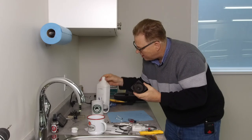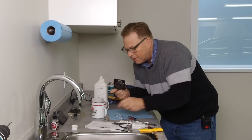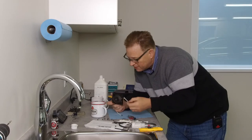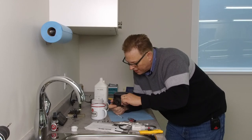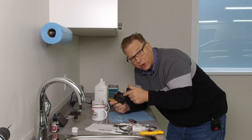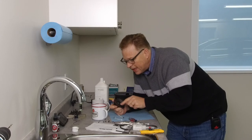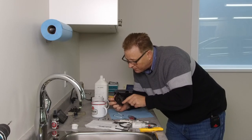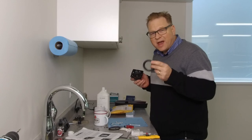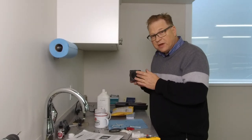So now what we're going to do is clean up some of this material. I have a little screwdriver I'm using as a scraper. There's glue on here — it's a bit gummy, kind of like rubber cement, only it's black. I have a little bit of paint thinner which I've put into a cup, and I'm just dipping some Q-tips into that to clean the rest of this off. I can put more on the edge than on the actual speaker because the speaker is a paper cone and we don't want it to get saturated. If you just rub it, the glue kind of rolls off and you'll get 90% of it off. In the instructions, it says some foam rings you have to trim depending on your speaker size, but this fits absolutely perfectly — it's a three-inch size.